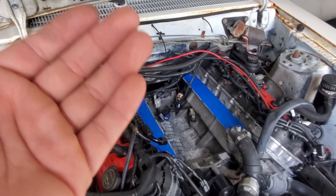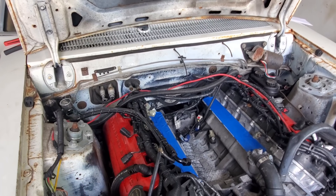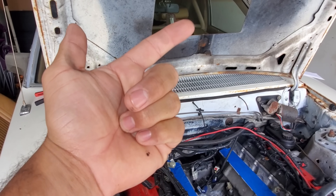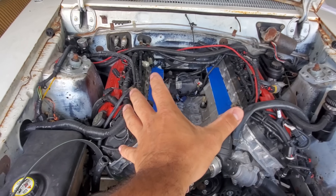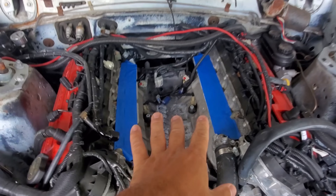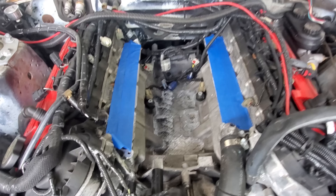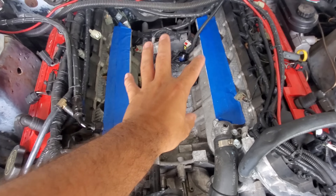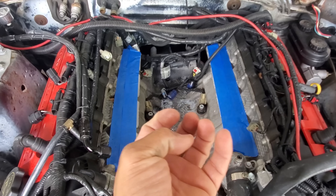How do you tell if the knock is false? With false knock it knocks right away — instantly, not even building rpm. Or on a run-up it's super high, or on a shift: you go to shift and it spikes, then tries to add timing the rest of the way — that means something jolted on the shift. This car has solid motor mounts and a blower on top. Are we going to keep the same knock sensor sensitivity on a blown, solid-mount vehicle as stock? Absolutely not. A supercharger creates its own frequency from the belt driving an additional air pump, so supercharged cars need different knock sensor sensitivity.